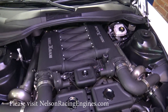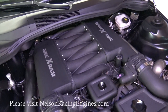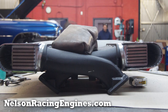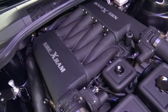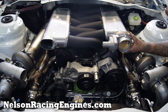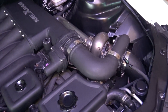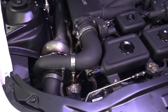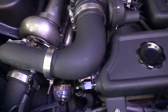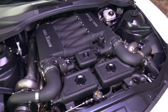It's got our X-Ram intercooled intake — this is our very first intercooled X-Ram. We made a rapid prototype, 3D printed it, flowed it, and dyno tested it. Inside you can't really tell, but that's where the water-to-air intercoolers are in the intake. From the intake it goes to twin 90mm drive-by-wire throttle bodies. We took them apart, welded on V-bands, had them wrinkle coated. These are our NRE 72mm mirror-image turbos — we hand-formed transitions from 2.5 to 3.5 inch V-band, hand shaped, welded and fitted them up.